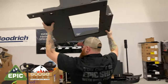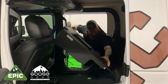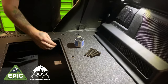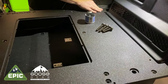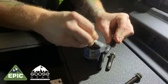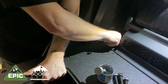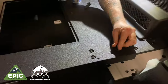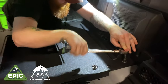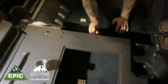Have your ginger pick up the assembled 60% platform unit and place it on the passenger side of the vehicle. Grab the Goose Gear provided hardware shown and apply a liberal helping of anti-seize to each bolt. The shorter bolts go at the back of the vehicle while the longer bolts go towards the front. You may experience issues installing the newly provided bolts — we had problems with four out of the eight. If you encounter issues, it would be a good idea to chase or clean out the threads prior to installation. At this stage, you can tighten the middle support board as you will not be able to access it later.